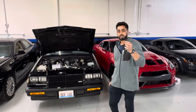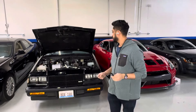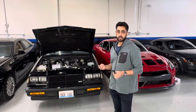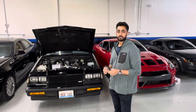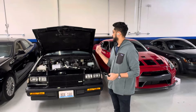I actually have a PCV off the car currently. This is a new PCV — we've tested a few of them. The issue this car was having, under boost, is that the car is tuned now with a turbo tweak chip on it, so the PSI went from like 12 or 13 to 15 or 17. We're running the stock turbo but with a little more excess PSI.